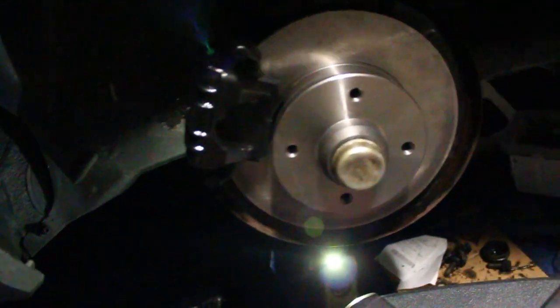Just like that we have a fully complete side - rotor, caliper, brake pads are in there, wheel bearings are in. The e-brake is actually about two inches too short to latch into the hook. I'll probably just loosen the e-brake up top to give some more cable and then hook it in, but that's a pain because I have to pull out my carpet and center console. So as of right now there's no e-brake - we'll leave it in gear.